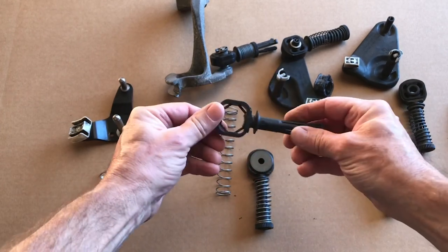The MQ350 — the six-speed — and the MQ250 — the Mark 5 five-speed and 1.4 six-speed transmission — had one of a few different cabin shifter assemblies installed. This is a Mark 4 shifter box, basically the same as a Mark 5 — it has a metal plate up top. The specifics of the box don't really matter; it's all the same pin and the same idea. You go through the upper loop with the pin, then navigate the stick so the pin aligns with that lower loop. On cars with an injection-molded plastic socket, it can be a little bit difficult to get started, but just give it a wiggle and a twist.